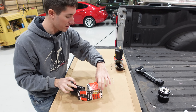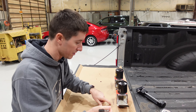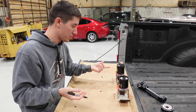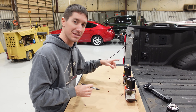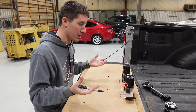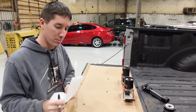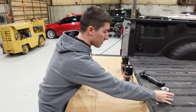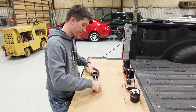Okay, we're gonna label what our filters are here, and this is to the best of my memory. So this is the original — I know that — probably a 10,000 mile interval oil change. It's the one we took off the car, an extended life filter. People were saying extended life filters actually are worse filters. They have higher micron tolerances to let junk through the filter so that they can run longer without clogging up. That's an interesting idea and probably true. It obviously makes great sense. And then over here we have rinse oil. There's our filters all laid out — let's open this thing up.